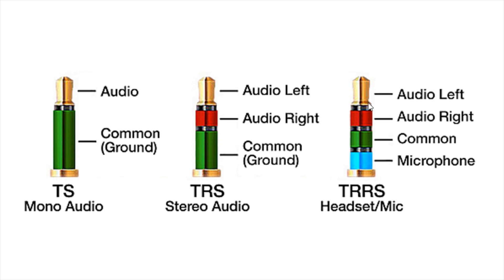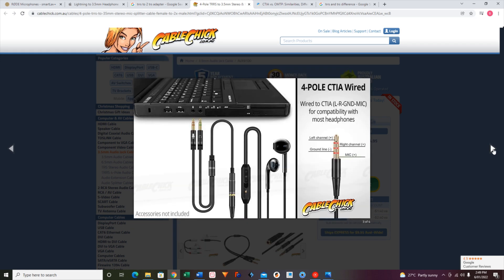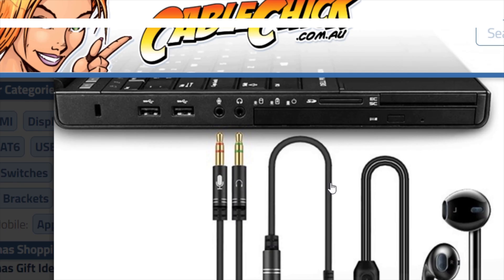iPhone uses microphone and speakers from the same port, and that's why it'll work with your iPhone once you get that lightning jack adapter. But your PC most likely is using TRS. On your laptop or PC, you would find that your headphones and your microphone are split — they have their own separate ports. The TRRS has the microphone and speaker on the same jack, so there's your problem: you're plugging a TRRS jack into a TRS port on your PC or laptop. So you need an adapter.